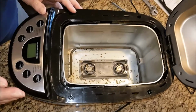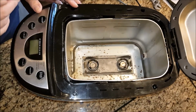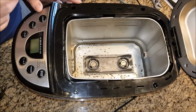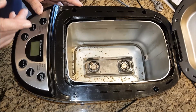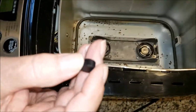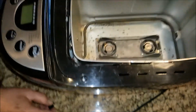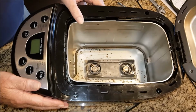In addition, the top is held in place by 5 1/2 inch sheet metal screws. I've replaced those 1/2 inch sheet metal screws with 3/4 inch so that I get a better bite. After the screws are in place, you snap the caps back on in all 5 locations. I'm now going to reassemble the top to the bottom.